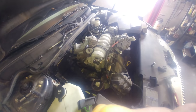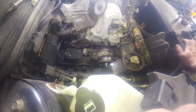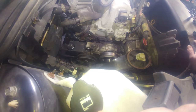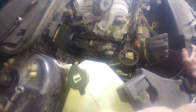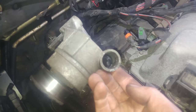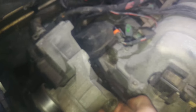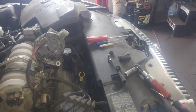Keep this thing pointed down so the stuff goes down and doesn't come up. You'll see no fluid came out of here because it's low — that big hole kind of blew it all out. But you'll probably have some coolant coming out, so catch it below in your container. Be careful that you get everything out because you don't want a restriction. Make sure you get that out and wipe it all down with a rag. Got the other piece out of the other hole over here. Just screwdrivers and a pick — work it out, use a rag, clean the holes out.